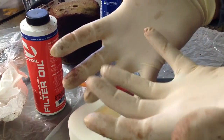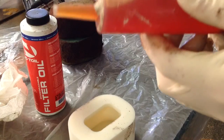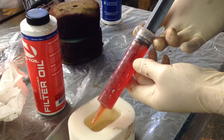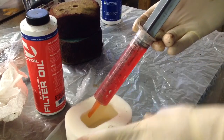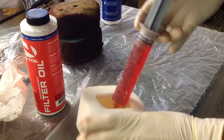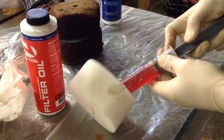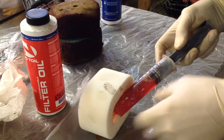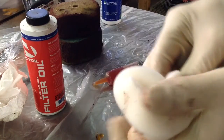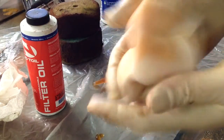I like to use gloves when putting this stuff on. Here's two ounces of foam filter oil — I'm going to put it on half an ounce at a time. I put it on the inside of the filter; it's easier that way. I borrowed one of my wife's horse syringes to measure it a little more accurately. You can see inside there's quite a bit of oil, and then I'll just begin to work it into the foam by squeezing it.